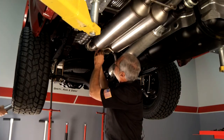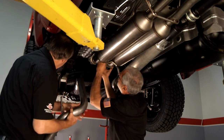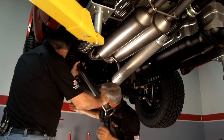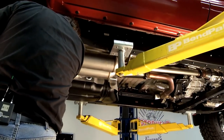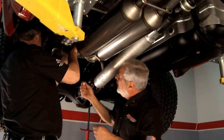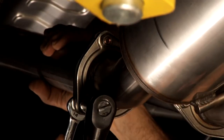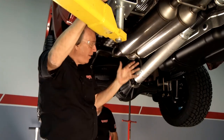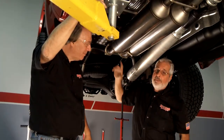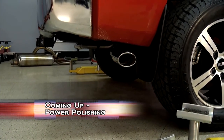These are really nice flanges — three bolts, bolt up well. You get all the hardware and seals in the kit. Check your tailpipe clearance against the body, but it fits perfectly. Make sure your tips are lined up. These flanges are welded on the pipe, so it positions the tailpipe tips perfectly with the exact same clearance on the body. It's going to add the performance you need from TRD. We're going to take a short break — we've got a lot more coming here on Motorhead Garage.